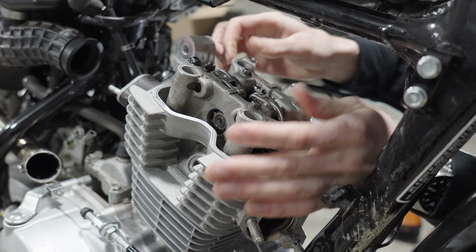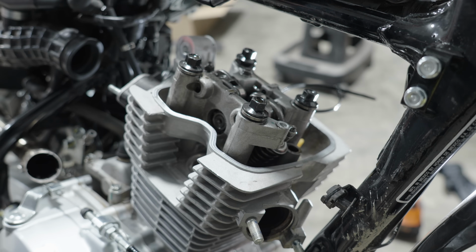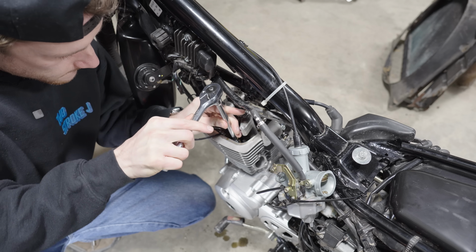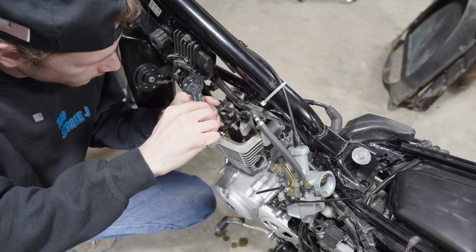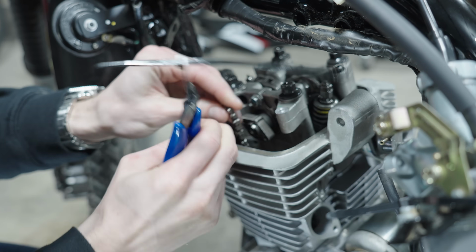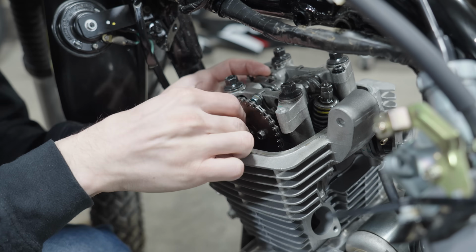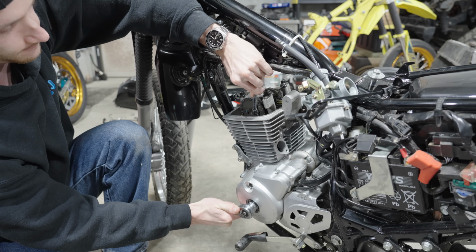And after putting the cam assembly back into the top end, I looked up the torque specs for all the bolts to make sure everything was tightened to OEM specifications. The last thing to do was to reinstall the gear on the timing chain and make sure that this thing didn't slip timing at all during the reinstallation of the cylinder.